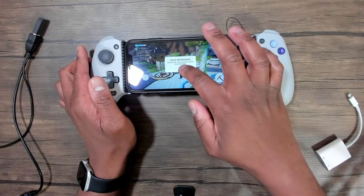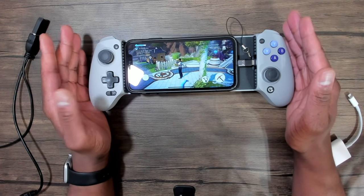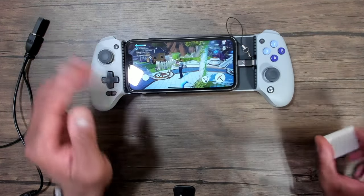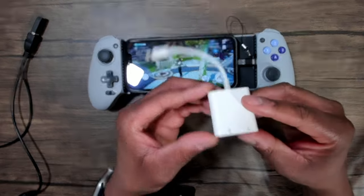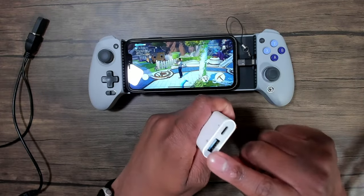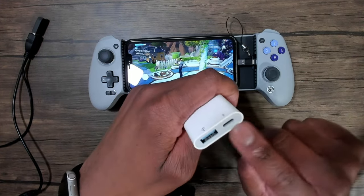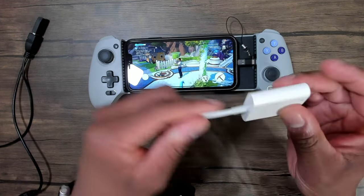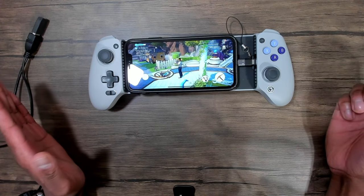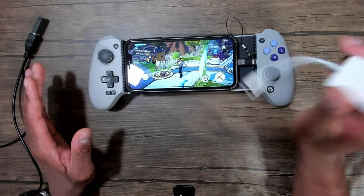If I can line this up perfectly — this is another issue — you're going to have problems ensuring that you don't break any of your stuff. This is why I don't suggest it. As you can see here, it's basically saying that the GameSir G8 accessory requires too much power. This is an error message that you would get if you were to plug in an external SSD drive. To solve that, you would have to get something from Amazon that would allow you to plug this into your iPhone and use a USB 3.0 connection.